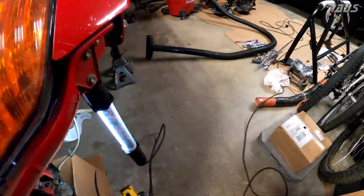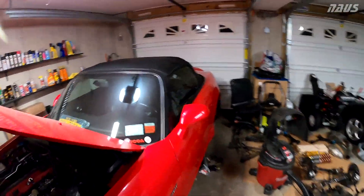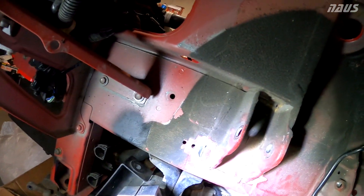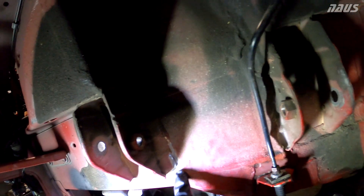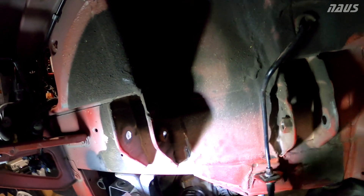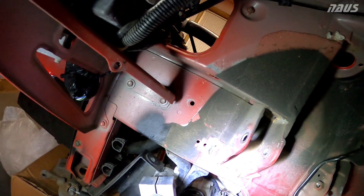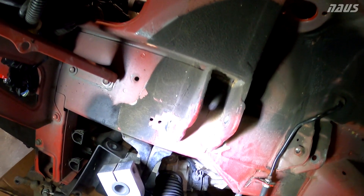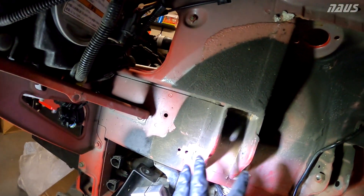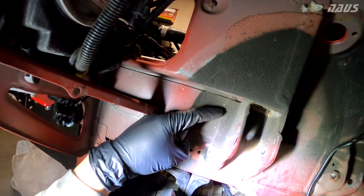Welcome back. This really kills me inside to do — taking wire brushes to the factory undercoating of my pretty mint Honda S2000. As you can see, I already started scrubbing the undercoating off of these control arms on the edges, and I will continue to do that until I have a nice clean seam all the way around. Tomorrow morning my buddy from work is coming over and we are going to weld the seams of these control arm mounts, just like the Honda Technical Service Bulletin suggests on an AP1 and early AP2.